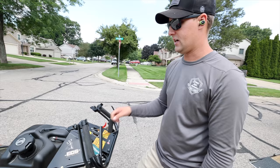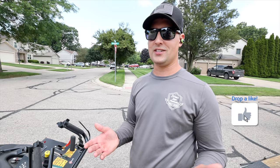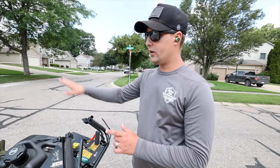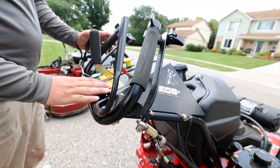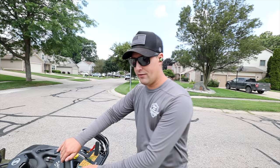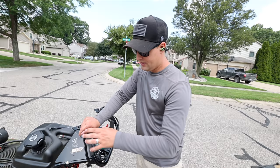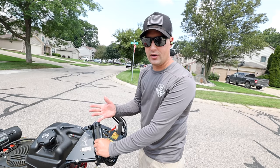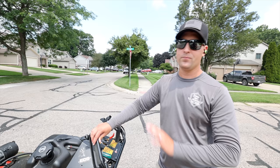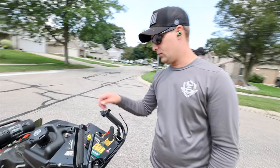The biggest thing I can leave you with: this right here is your lifesaver, this is your safety. If you push forward and the mower is getting away from you or you're rounding a house, you have to let this go for the mower to cut off the blades and stop. Do not ever electrical tape this closed. Some guys on older units tape it shut — if the mower's in gear, gets flung off, or rolls off a trailer, it won't stop. Never zip tie these, never put electrical tape on them. It's a big safety no-no.